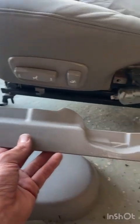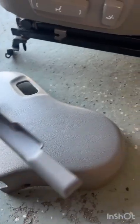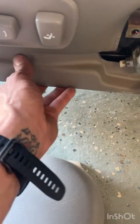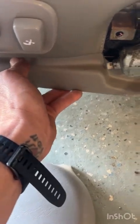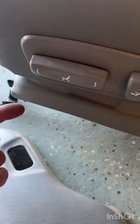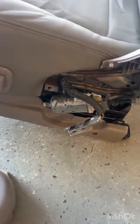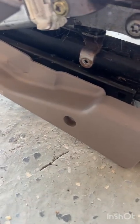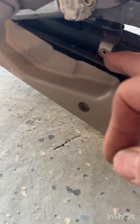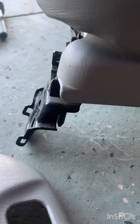Now remember, this piece of trim that we've got to slide backward into place, this one goes underneath this piece, so we've got to put this in first. So we're gonna get it roughly lined up and slide it backward until we feel that front clip catch. Then we're going to take another one of our fine thread pitch screws, and screw it in right down into this hole here. It's gonna actually go right there. Voila, that one's done. I felt underneath here to make sure that the clip was aligned correctly. Lines up just about with the end of the rail right there.